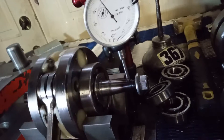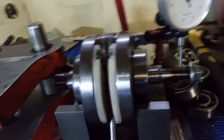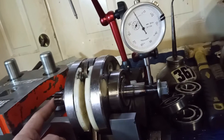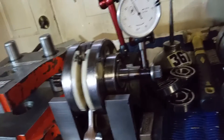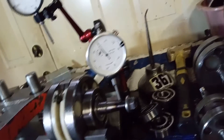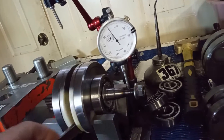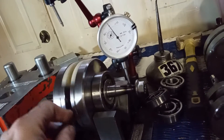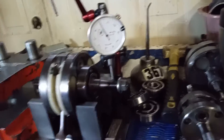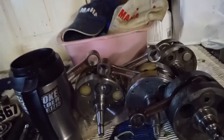If that — so the crank is really true, and I didn't true it. That goes to show you how tough these cranks are. I know how I split engines: I put the bolt in, use a socket and hammer, and usually split the engines apart real fast. A lot of people think that'll knock it out, but it definitely doesn't. This crank is still OEM spec, almost perfectly true. You put the indicator in here and that dial would barely move.